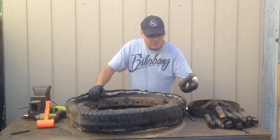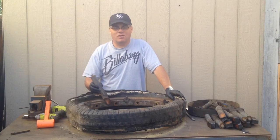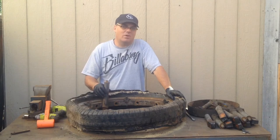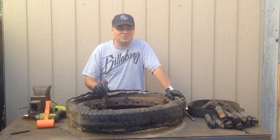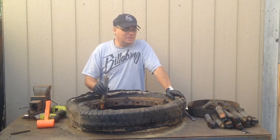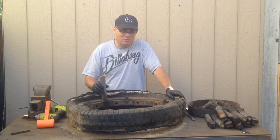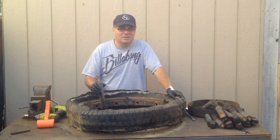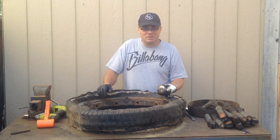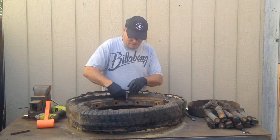And I wanted to say, it was really sad to take these spokes out because these on the right side of the car were in great shape. They probably would have been okay. But we're going a long way and I have my family in the car, so I decided it's probably better to replace them all. But they probably didn't need it, and it was really hard for me to break down a couple wheels that were in really good shape. On the left side of the car, those were history. They're all dry rotted, but these on the right side were really good. If I weren't going across the country with it, I would have used these two wheels. But since I am, they got replaced.